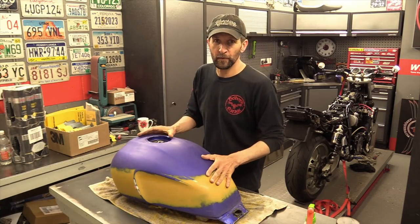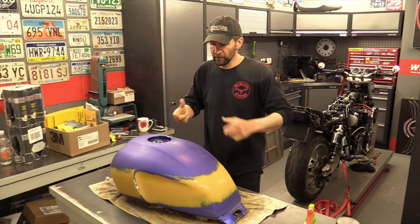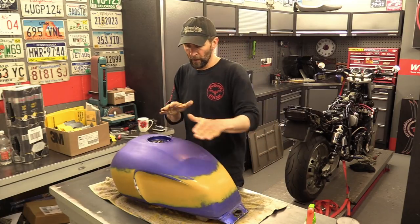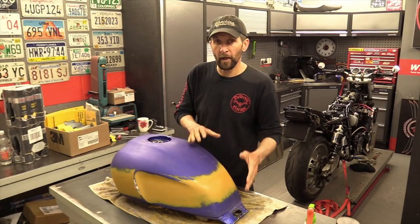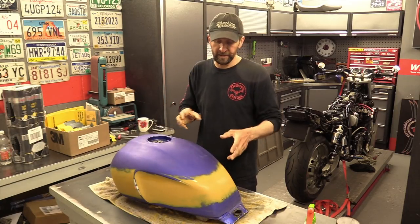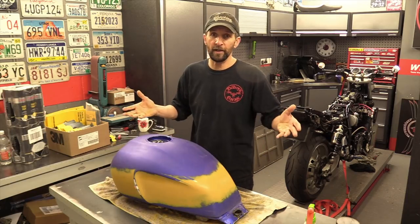So that's kind of a sacrificial coat, a guide coat. A guide coat is many things. It can be a dust, literally a dust coat over the top for the purposes of rubbing down, so you know where you have and have not rubbed. So it's guiding you for rubbing down. Also, it can be a visual guide to where there's any imperfections. So then you need a solid coat, so that guides you. So a guide coat is many things.